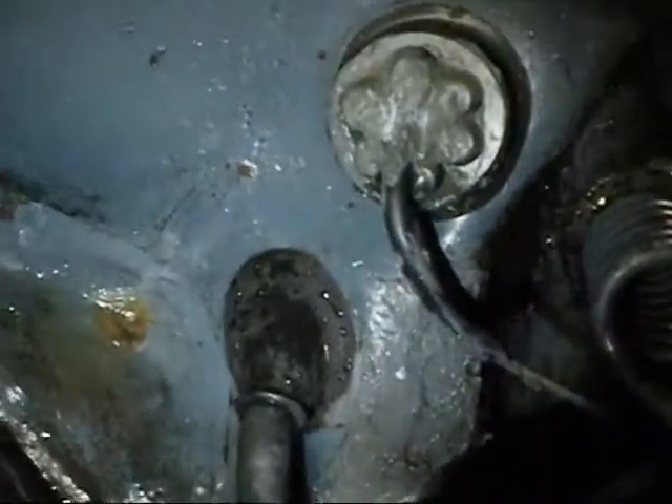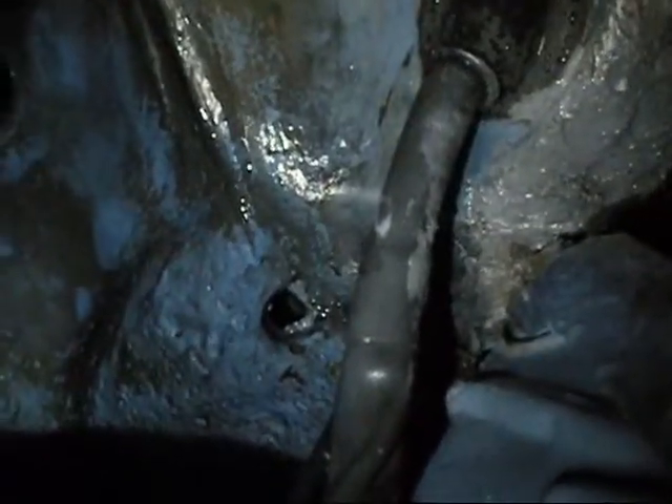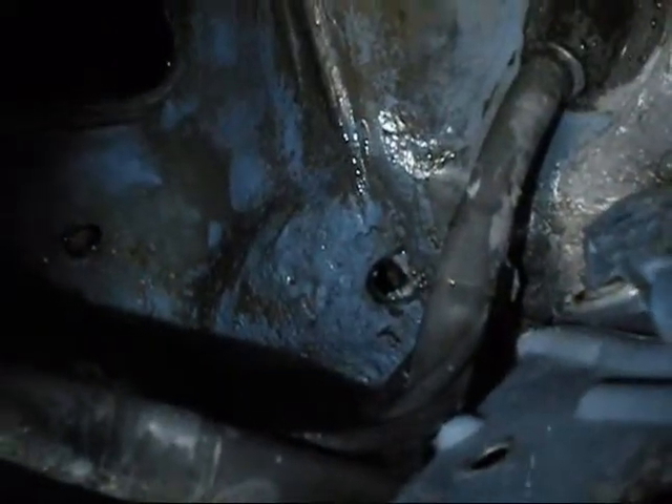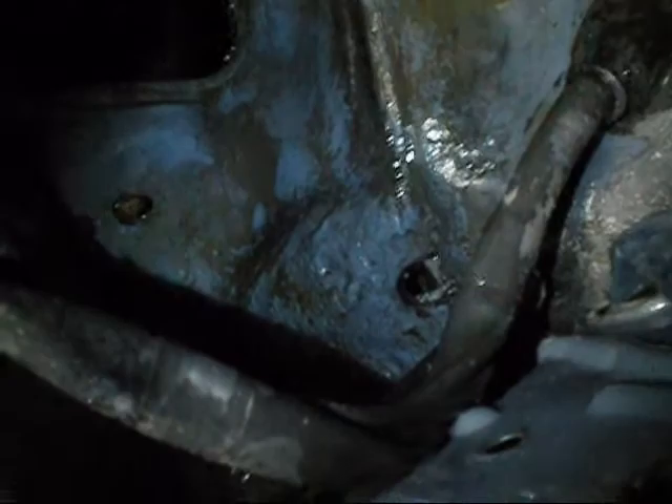There should be a drain down there. Oh, there we go — that's much better. Someone's done some sort of repair there, or tried to stop water getting in the cabin — just put some sort of putty stuff around the place and put it on rubber. The drain hole was quite blocked. It's all clean now. Put the plastic cover on there, because all the water from the windscreen and everything goes down that corner. And that was just, as you saw before, like a dry creek bed — it was pretty bad. It's made a mess with the driveway, I tell you.